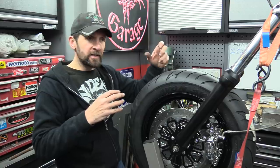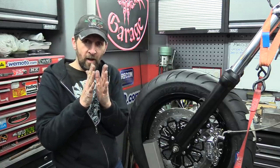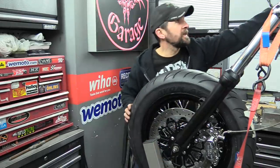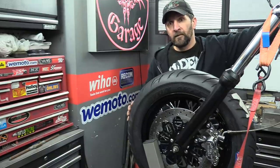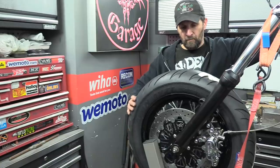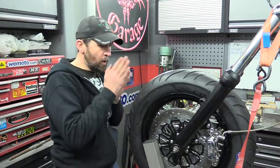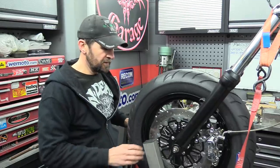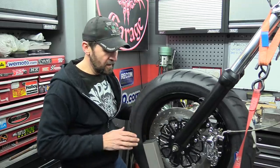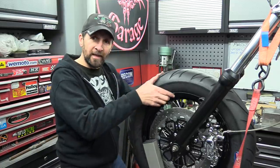If you apply the brakes, pump them up so that the pads will come out equally and they will touch the disc and hold it central, and then I can check it on the center line of the caliper. So just a few pumps on this. There we are. Right. Now I've got the pads out on the disc, nothing binding, in fact, it's binding on the lip. Right, there we go then. That's it. Centralized on the pads.